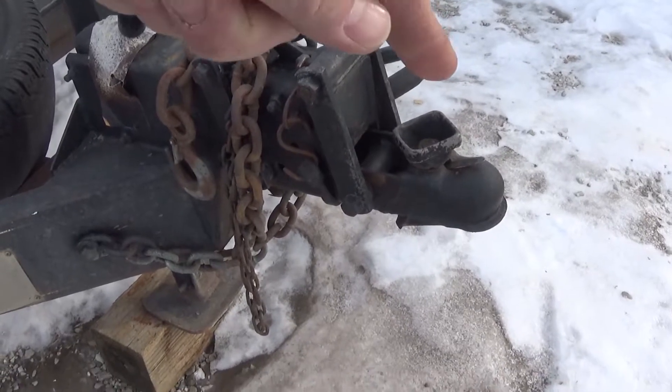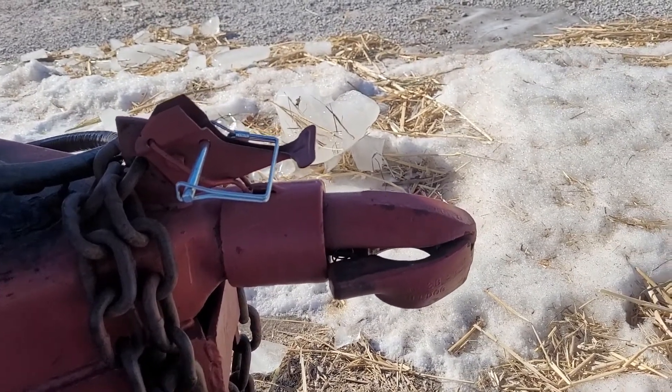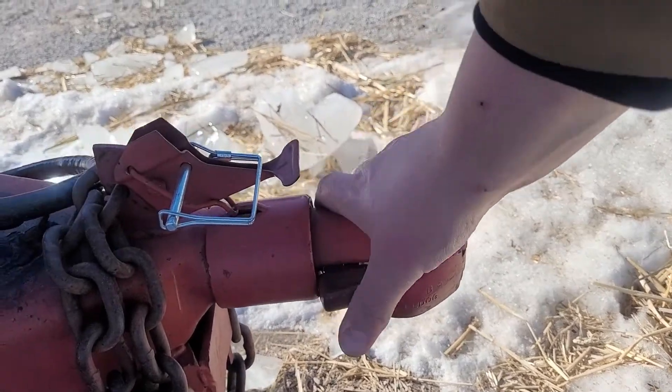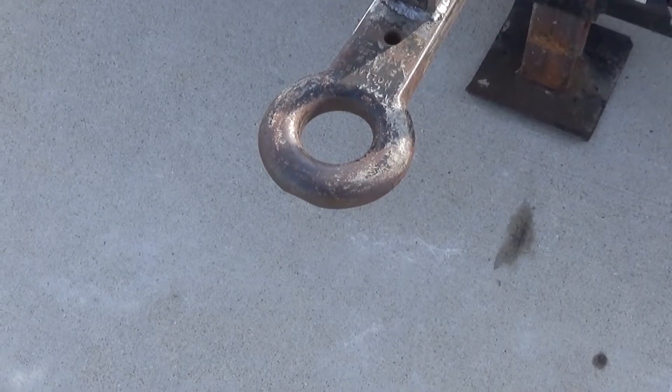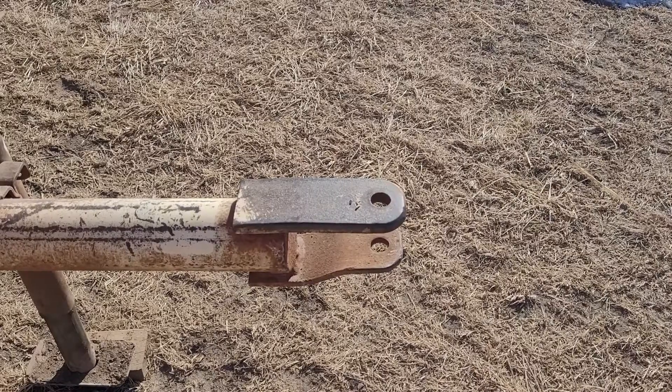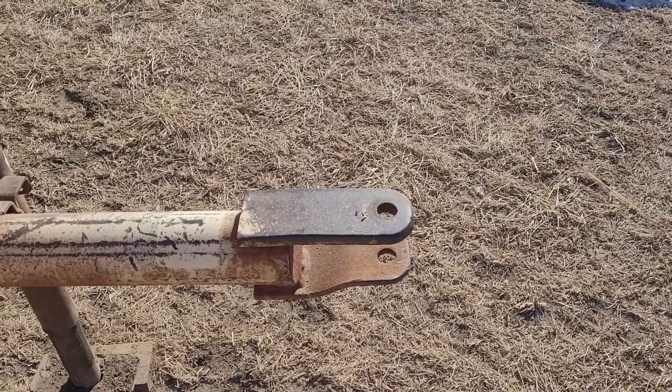The only difference is the latching mechanism. If your trailer tongue looks like this, it's still just a ball mount - this piece squeezes closed over the ball and this coupler slides forward. This is a lunette ring. If your trailer has this, you'll need a pintle hook. And if your trailer tongue looks like this, you just need a draw bar or a ball mount to drop a pin through.